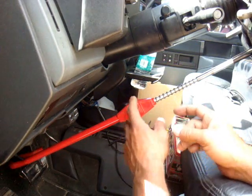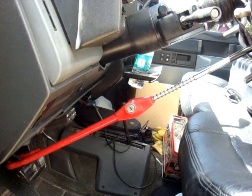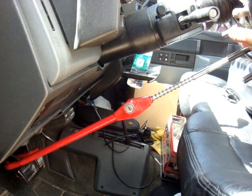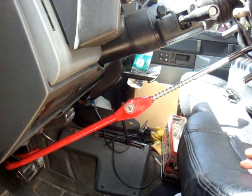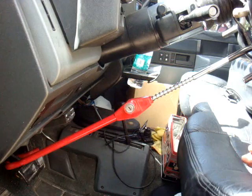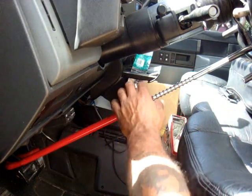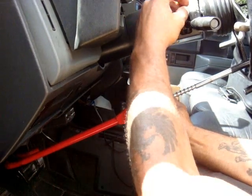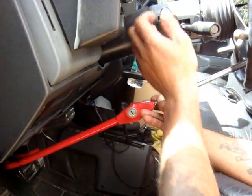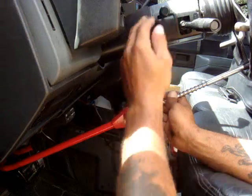I have this on a brake club that I don't have a key for — it's totally open, as you can see. What I want to show you first is: when you have one that's locked, a lot of people drive with their steering column tilt wheel in the up position. First thing you want to do in the field — if the vehicle won't start and you need to maneuver it out — is lower the tilt wheel all the way down. A lot of times you can almost take the club right off just like that.